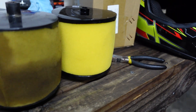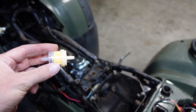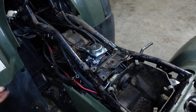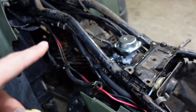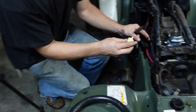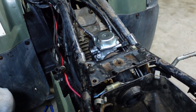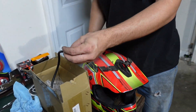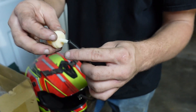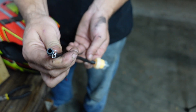I was going to show a comparison between the new air filter and the old one, like we did with the carburetors. I was also going to do the same with the fuel filter, but me and Jotham looked for the old fuel filter and there was none — it was going straight from the gas tank to the carburetor. We're going to throw in some old gas with the new carburetor. It came with this small fuel line, which seems really tiny for a four-wheeler.